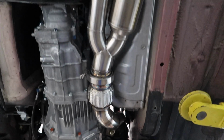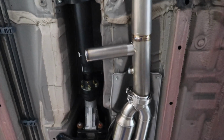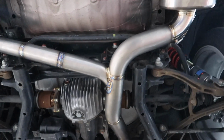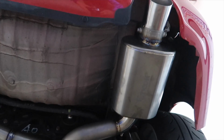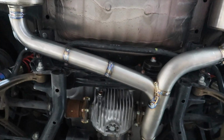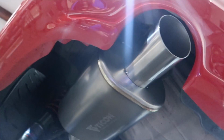All right, so we have our downpipe braced, our double cat right there. Going into titanium, we have our Helmholtz resonator in the factory position, the same dimensions, a 3-inch coming back here and splitting. So we have a dedicated 3-inch here into our valved section. And then we have a branch off of a 2.5. This is actually a decent merge right here. It's cut all the way out, so it will move enough airflow. But of course, it's going to go to a dedicated 3-inch when it goes into boost. Once that valve opens, it's boost activated right there.